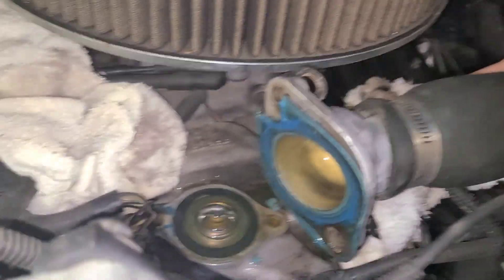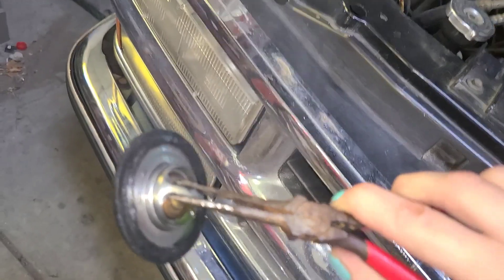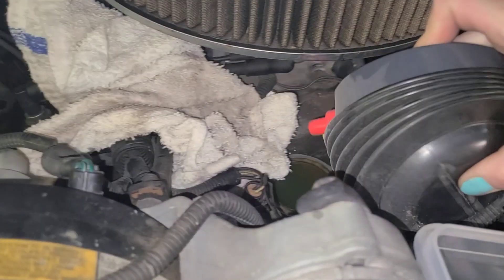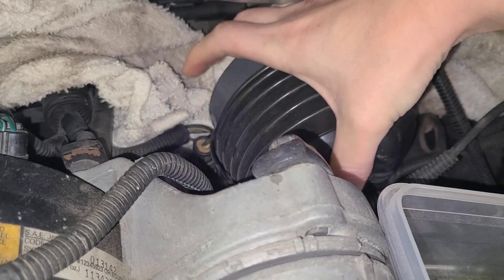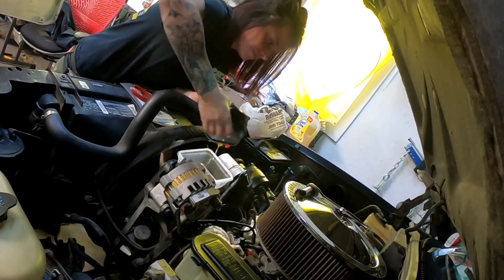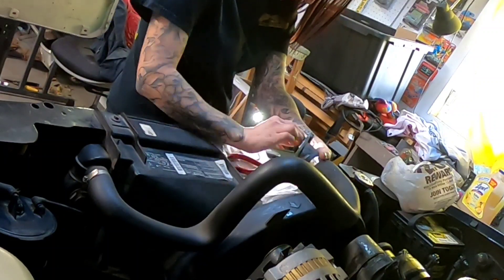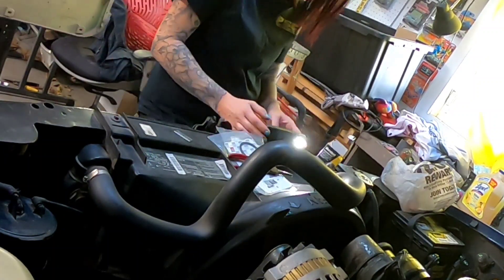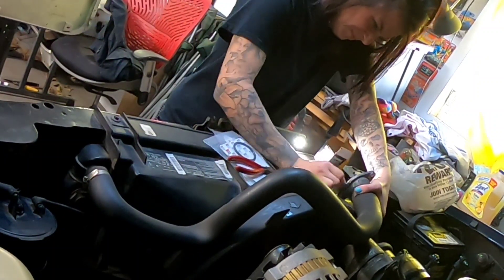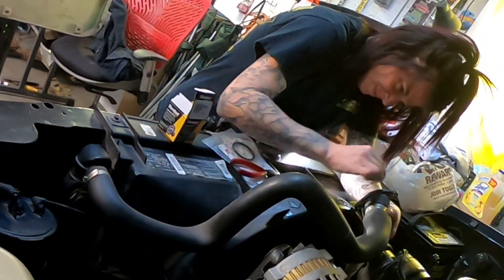I know what you're thinking — it's too hot — but it's not; my shop is just cold. If it was too hot it would have just exploded everywhere. I'm using my little sticky device here to remove just a little bit of coolant so that when I put the new thermostat on it won't leak out. This gasket was burnt on pretty good, so I'm taking a razor blade and gently scraping it off. You don't have to go digging at it — just use a little finesse and clean up the rest.